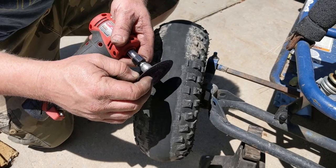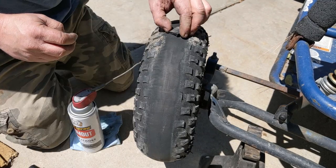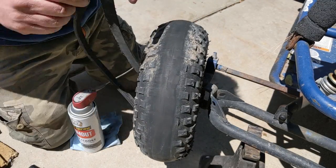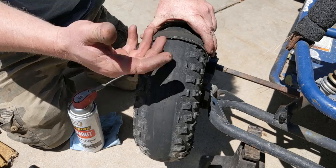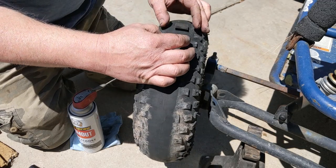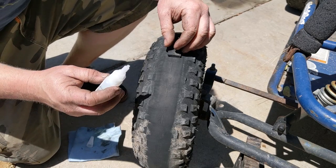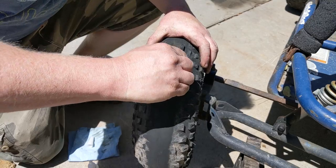I do think I like a 60-grit roll lock sanding disc better than the dedicated tire buffer — I think it leaves a better finish. You could make yourself some custom patterns, like tri-ribs or something. If you're doing a garden tractor, you can make chevron patterns, or even wrap them around for non-scratchable snow chains. But I'm just going to glue a couple little blocks right on. We'll just go around and glue them every couple of inches. In all honesty, a tire this small I would probably just buy a new one — they're cheap enough. But this is for science.